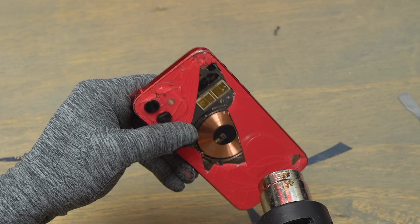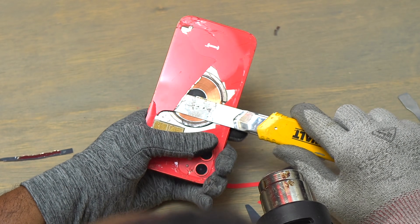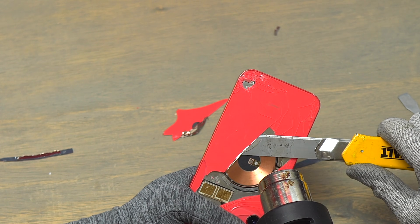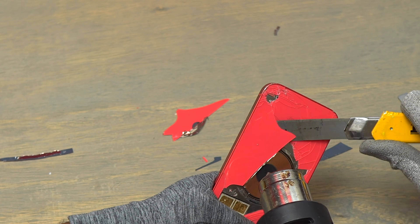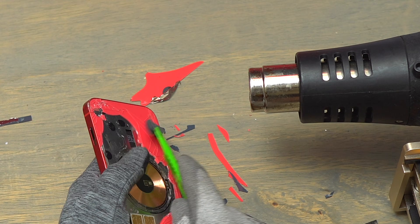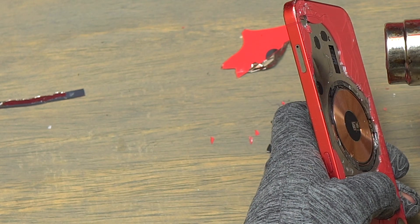The magnets on the back of this device might get damaged, cracked, or taken out with the glass while you're trying to remove it. This is why using a big blade is not good — you're going to take everything and the magnet might get in the way. The way they attached the magnets — directly with glue or double-sided tape to the glass — makes it very easy to crack them or remove them with the glass. If you're very careful, you may be able to remove the glass without disturbing the magnet, but there is no guarantee.